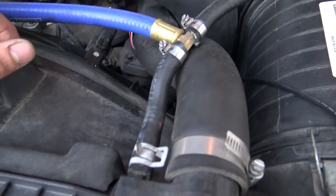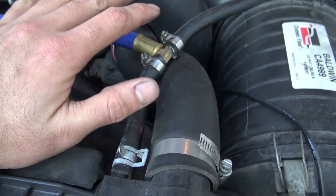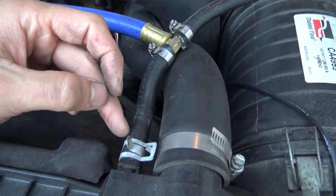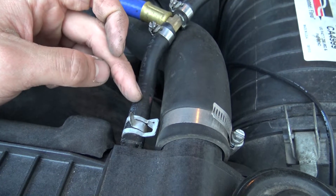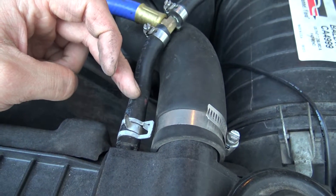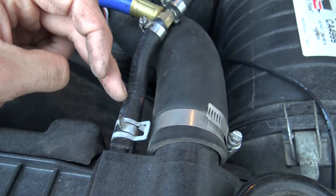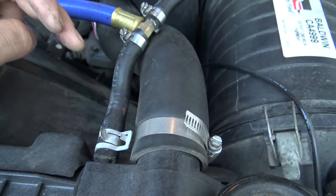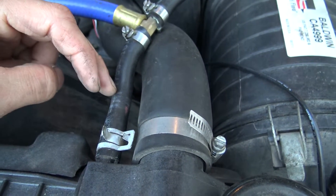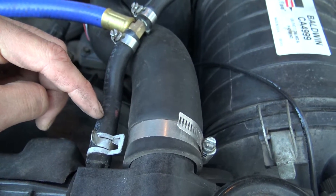Back over here I've got the radiator. If you're changing out your radiator or messing around here at all, be sure you take special care working with this. This barbed fitting does like to snap off really easily. There is a fix — you can tap the threads and put a brass barbed fitting on it, or you can just get another radiator or get an aluminum radiator online and you won't have that brittle breaking issue.